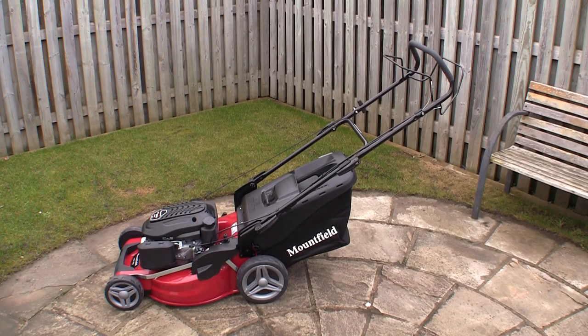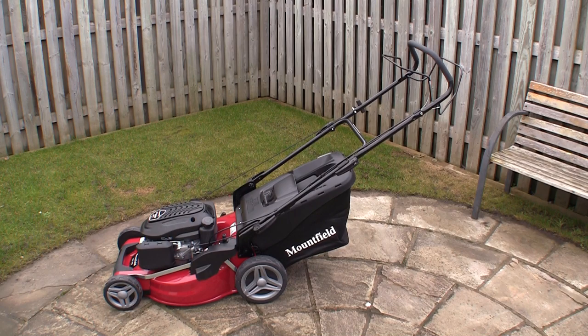So finally we get to attempt to start this lawnmower. I've not tried to start it yet. If you've watched my channel before, you'll know I actually do these things kind of live — so even though this is a new lawnmower, I don't actually know if this is going to start. There's no primer on these lawnmowers, so I'm going to pull the lever at the top and simply pull this over and it should start. I'm going to just lift it up at the back and demonstrate, hopefully, that the self-drive works as well. It's got an automatic choke system. If I pull this lever at the top — which is the operator control — this actually moves this part here and just releases the brake. So I'm going to pull that and pull this lawnmower over.